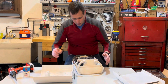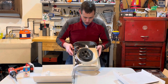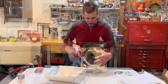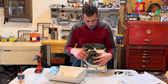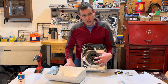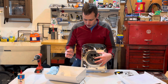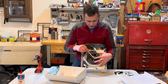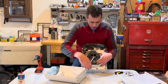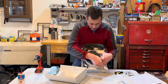Now I'm going to remove the back cover, and now I can see the fan motor down inside. Next I'm going to remove this nut so I can remove the fan and access the motor. This nut is held on with a 10 millimeter nut — I'm going to use a 10 millimeter wrench. You could also use a crescent wrench if that's what you have. So holding the fan blade in one hand and loosening the nut.